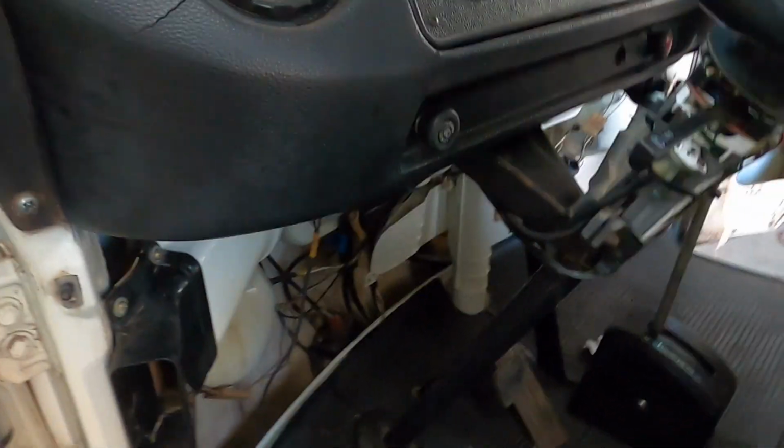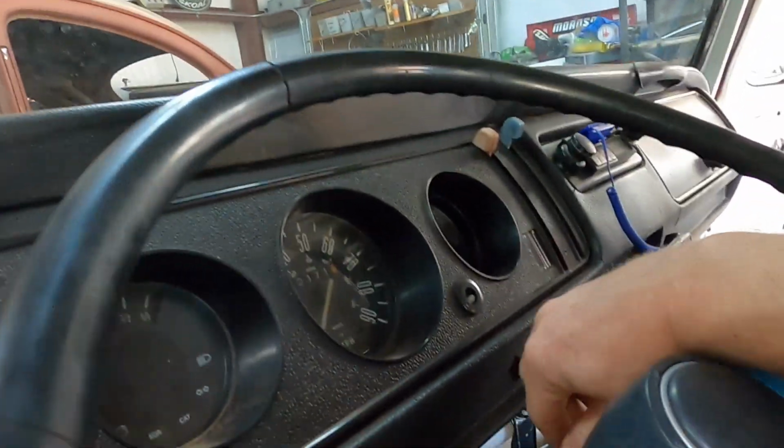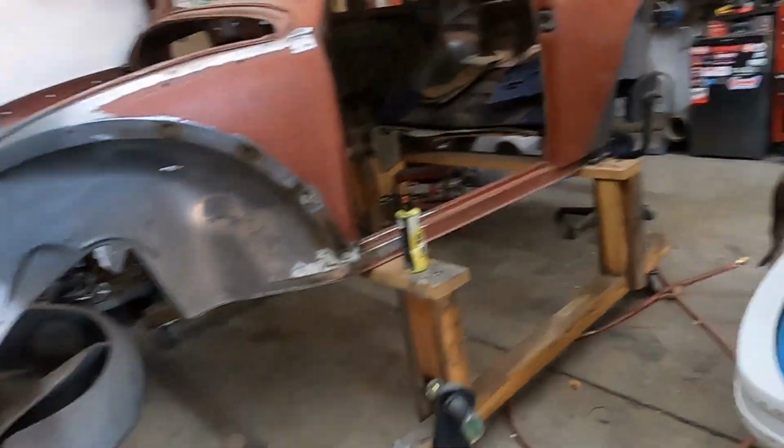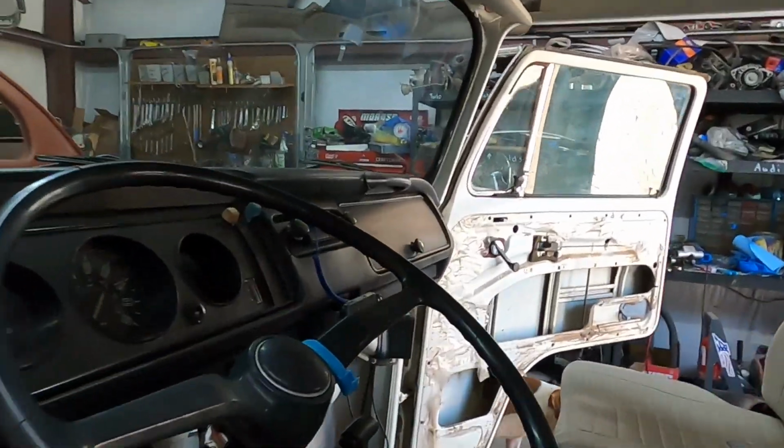So with the blinkers turning on now but not blinking, I decided to replace that blinker relay right there. I think it's a 522 or 552, something like that. But I wanted to show you that they work. Key on. You can hear it blinking. And now they're blinking. Hazard works as well if I turn that off.